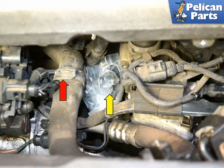With everything removed, squeeze the hose clamp (red arrow) and remove it from the thermostat housing. Make sure that if you have to remove the dipstick tube to give you better access, you cover the opening (yellow arrow) to prevent any coolant remaining in the hose from getting into the engine.